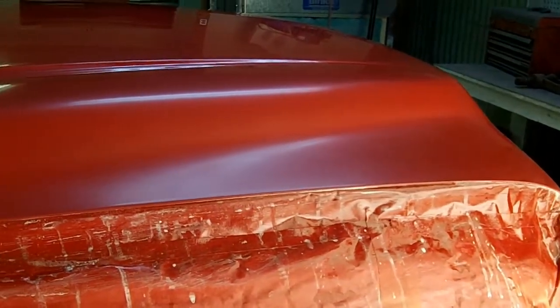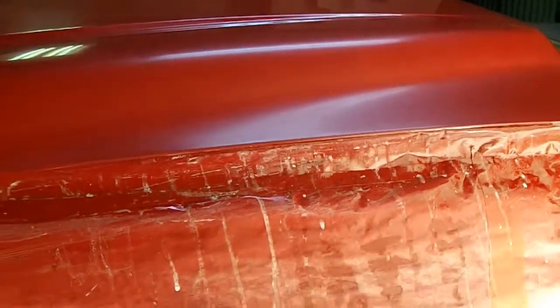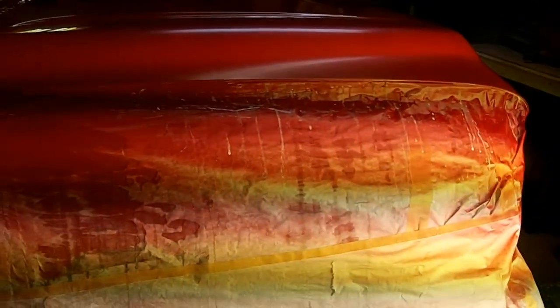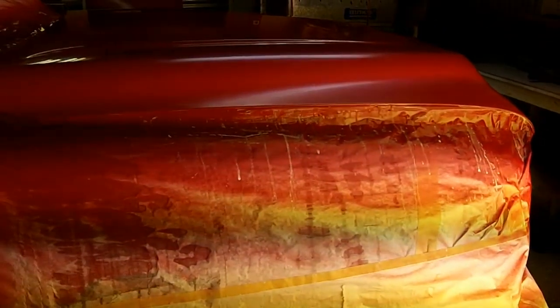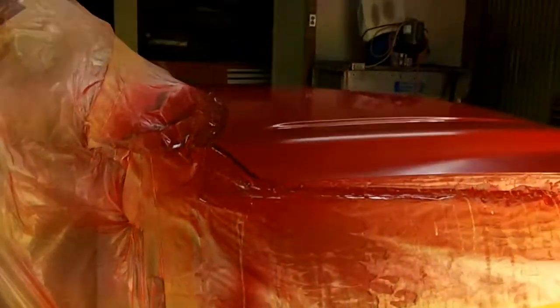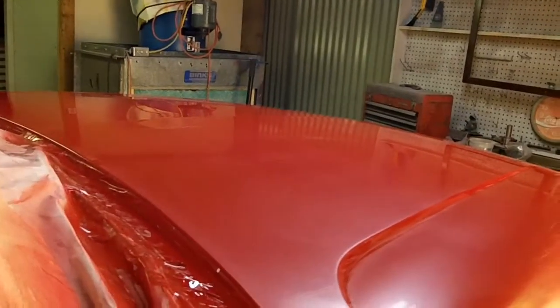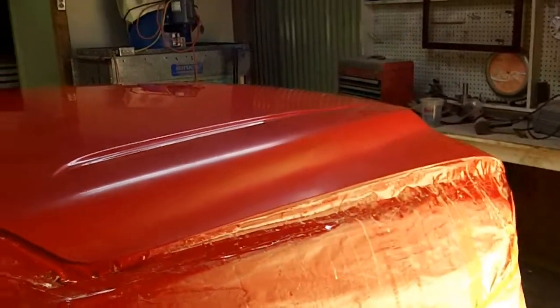I'll probably air the tires on the truck back up here just because I don't want them sitting so low. I don't want one of them to blow off the bead if it hasn't already happened. We should be okay, but that floor is pretty cold, so if one of them cracks off the bead, I'll have to jack it up probably to get it to come back on, or put a strap around the middle of it to push it out. That's one way to do it, but she's dull, but she's flat. Nice and flat, and I like that kind.